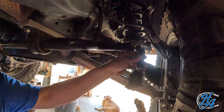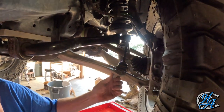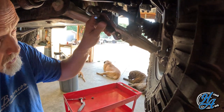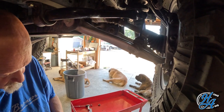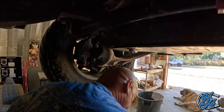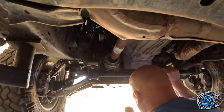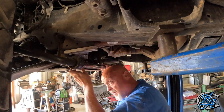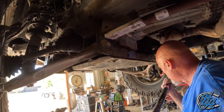These disconnects replace that solid link. You could just unbolt them, but with this kit you just pull the pin and undo it. While you're four-wheeling you just strap it up out of the way — it effectively gives you a sway bar disconnect. It's not going to fall off because it's still attached to the car.